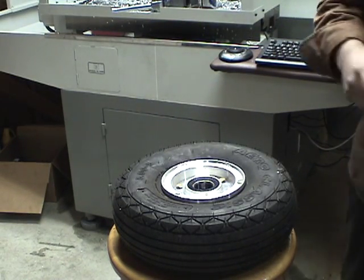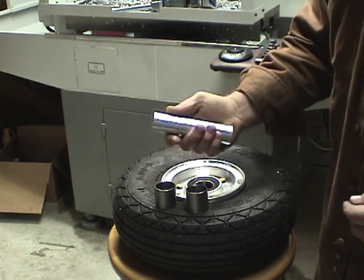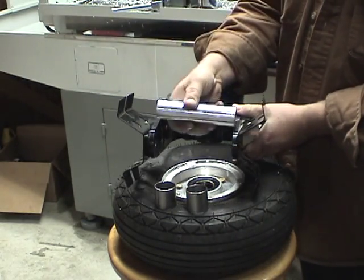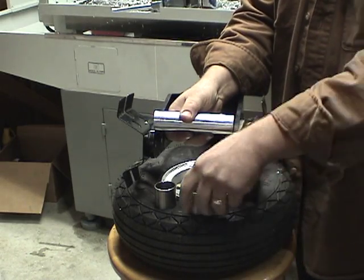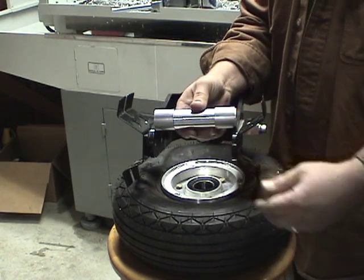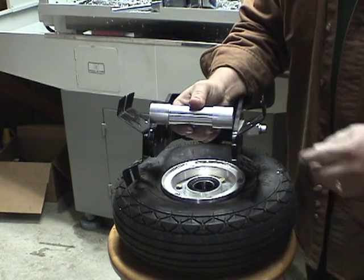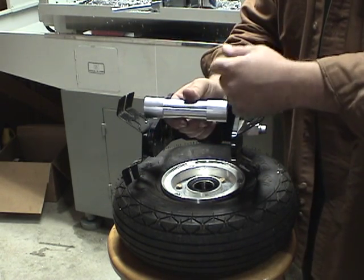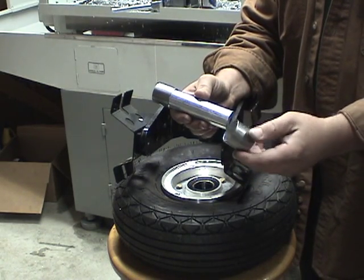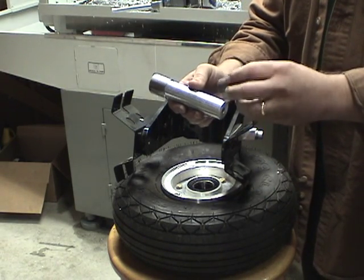Vans offers two different kits. This is an earlier kit — a full length axle, 5 and a quarter inches, fits right in between the forks. They have stainless collars that actually capture the wheel bearings. Now the wheel bearings are a little different than we're used to working with. This kit is a 205, and Vans changed the thin stainless collars to heavier aluminum ones at some point.